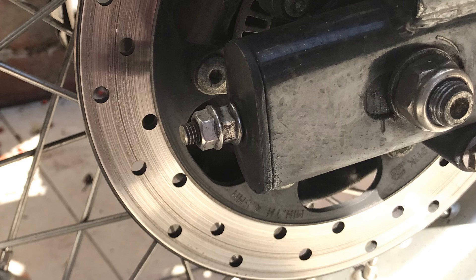This modification has been done by plenty of people before, but I'm going to outline how I've done it. It's basically to replace the stock chain adjuster. Looking at that picture, I don't think anybody could say that is a thing of beauty. I modified mine and put a stainless threaded bar in and a couple of stainless flange nuts. It's not exactly pretty, nor is it particularly accurate when you're adjusting your chain. It's very difficult to see the lines on the inside of that block where it goes into the swinging arm.